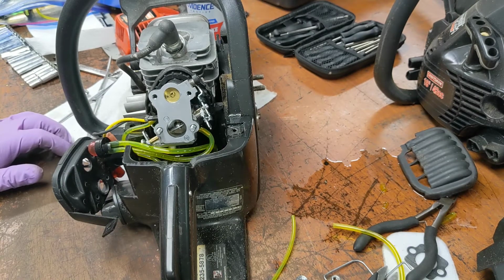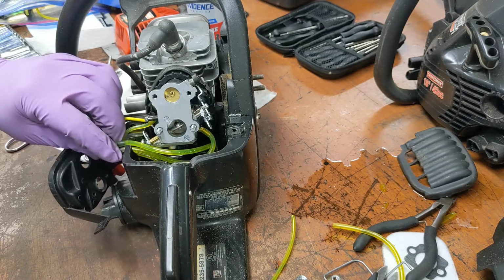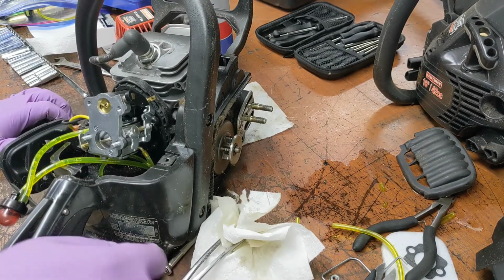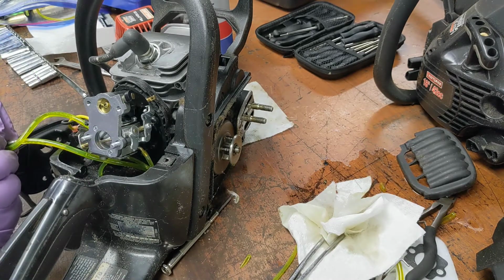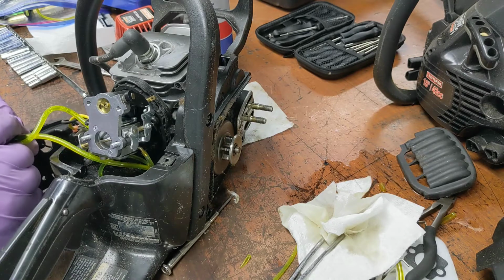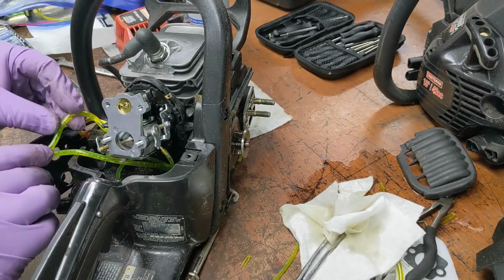Unless I trusted them and they've got the carburetor lines reversed, which is a possibility, I guess. That also, of course, wouldn't make it run right. Let me try that out and see what happens. Hold on. Okay, I believe that was it. If you watch now, press the primer bulb, it discharges out that chute, it draws it up into the carburetor on this side and out this side. It doesn't make a perfect seal, because the check valve isn't 100% perfect, but that's the way they're supposed to work. It's doing what it's supposed to do.